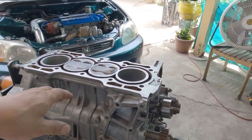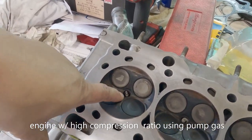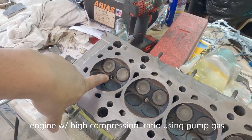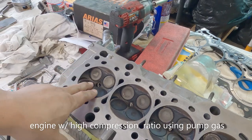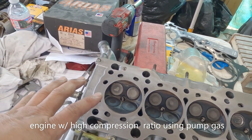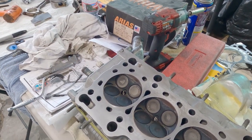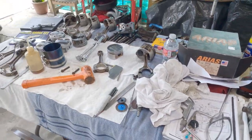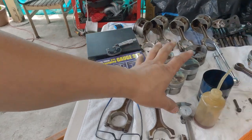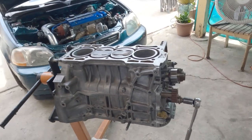The problem with running too high a compression ratio is the possibility of destroying your spark plugs — you'd have detonation before you even get ignition. It's an explosion inside the combustion chamber rather than regular combustion. So run E85 if you are running too much high compression. That's about it for showing you guys the connecting rods — I'll put this thing back together and show you guys. Thanks for watching, see you next time, bye.